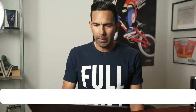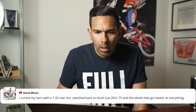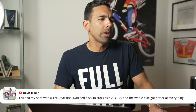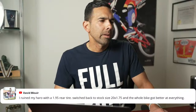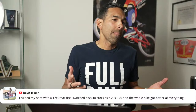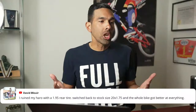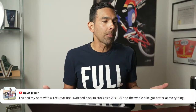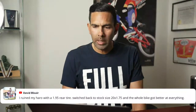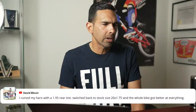What else do we got here? What other questions do we have? David Blur from Florida says, I ruined my Haro with a 195 rear tire, switched back to stock size 175, and the whole bike got better. Yeah, because 195 versus 175, you effectively change the center of gravity by lowering the bottom bracket just through a simple tire change. Has a really big influence. And I see another question you also have, Dave. I'm going to get to that here in a minute.